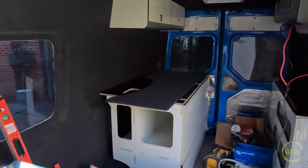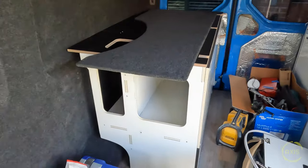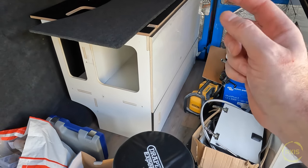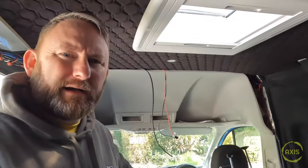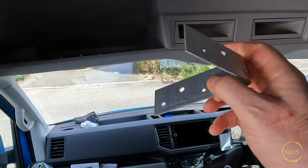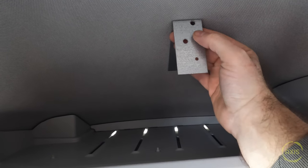This one now - just building this overhead red locker, aren't we George? And then we'll go mount it in the cab. So we've got some more units made up here now - we've made part two of the bed box, the other side of it. That one's going to have to be scribed at the back because it's set up with a top board for a pod, so I've knocked that back to get it back in further. That was an absolute nightmare to make because the instructions are really hard to read. One of the shelves doesn't fit - they've changed the design on the back section and the door's wider, so there's no mounting point for it. I'll send them a little video about that. Just made the overhead red locker now - Dorothy's just helped me. We're going to mount that up here using the stands, then mark off some brackets. We've got these little mounting bars that'll bond to the ceiling - I'll have to cut out the section in the headliner, bond them to the roof, screw them up, and that should give it a good anchor point.